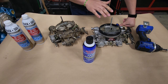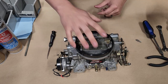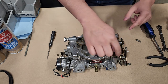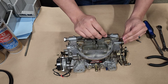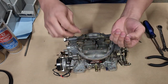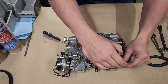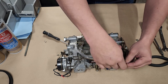Let's start by taking off anything on the outside that we don't need - starting with the filter spacer and the gasket. You need to run a gasket, I don't care who told you not to. Let's get these levers and little pins out. Use your pick to get in there and pop them out. If you buy a carburetor specifically an Edelbrock, your next purchase should be a rebuild kit, because these tiny little pins like to jump and escape - I've dropped one in the engine bay, the grass, a parking lot.